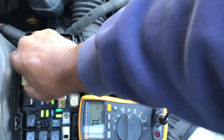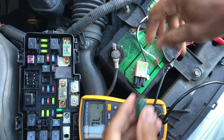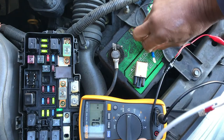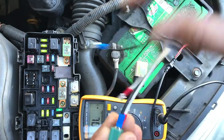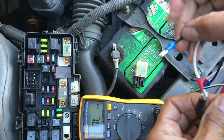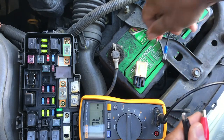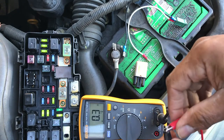Let's check those two components. We're going to take them both out and check them out of circuit with the meter and the help of the battery. Check the fuse first — we have some jumpers set up, standard jumpers you can buy at any hardware store like Harbor Freight or Home Depot. The spades go right in the bottom of the fuse. We have a reading of 0.4, 0.3 ohms — we've got a good fuse, it's not open. Lead resistance is 0.3, so the fuse itself is about 0.1 ohms.